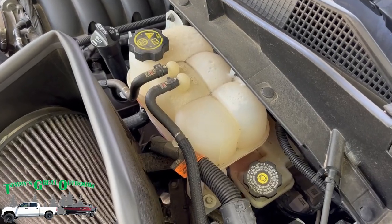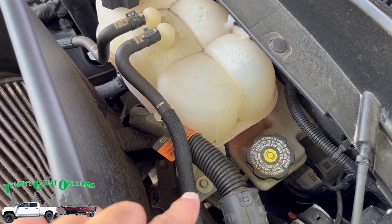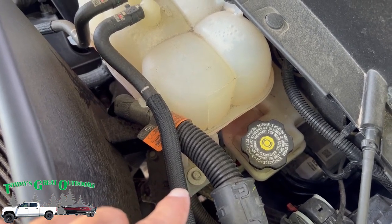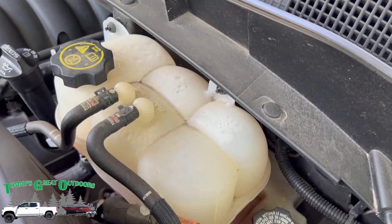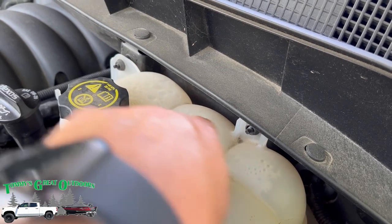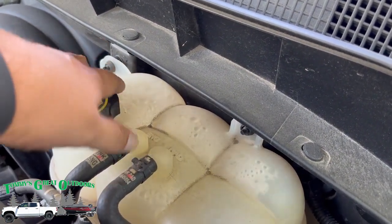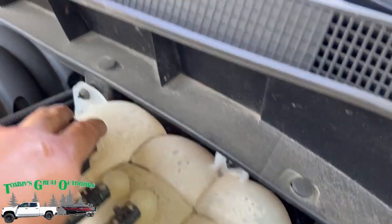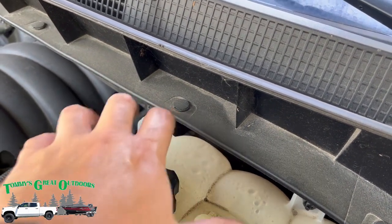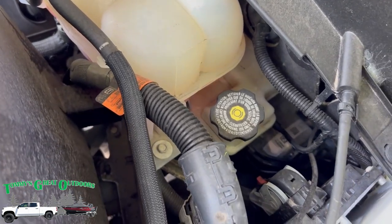Mounting this looks pretty straightforward. You can see down there, there's a bolt. Not sure what size that is, but GM likes to use 10 millimeters, so we're going to try that first. That bolt's got to come off. And then this reservoir has basically two threaded bolts here, but it's just kind of a stop that's on there. This is going to pull away like this. And we're going to mount that bracket right here, but you can't pull away on this too hard with that bolt down there. So this will all make a lot of sense here pretty quick.